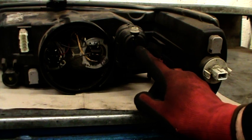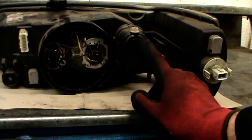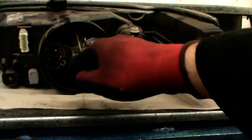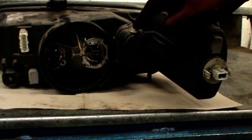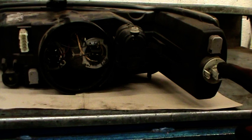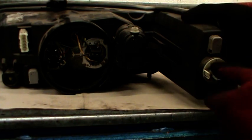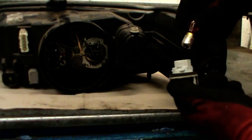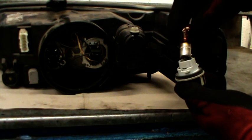Here we've got the aligning motor headlight levelling system. So if there's a situation where you have the back of the car loaded up and the front of the car is pointing upwards, to prevent blinding oncoming drivers you can move this motor, which will tip the headlight lens inside down. On top is also the manual adjuster for the height. Over the side here we've got the actual indicator bulb - this particular bulb is a little bit different. It's a push and twist, and it's an amber bulb with a very specific type of connection so that you can't put a normal clear bulb in there by mistake.